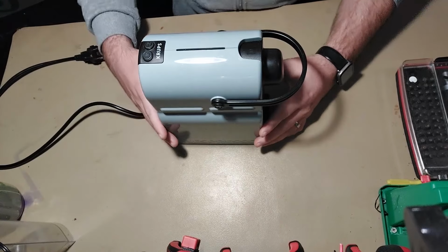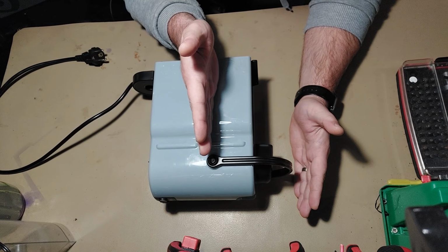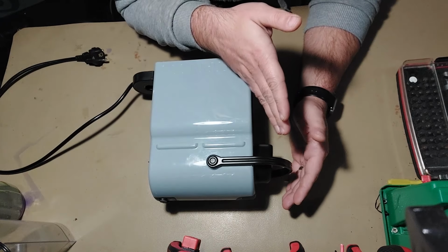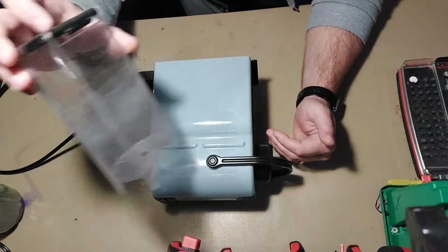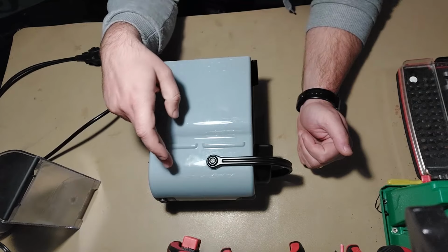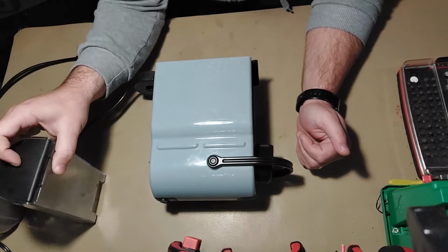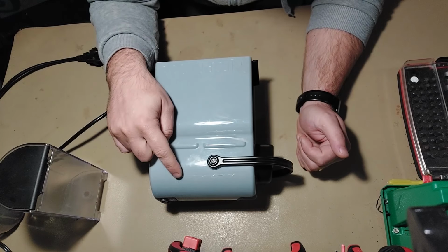All right, so basically we want to split the unit on two sides. The front side and then the end side, let's call it like that. In the front side, you will have hot water, because the water will come from the water tank through the heating element and comes outside hot. On the end side, you will have cold water, because the cold water will have to go through the pump and all the elements to reach the heating element.